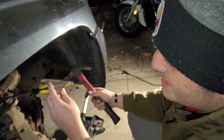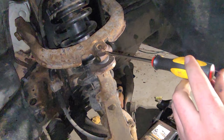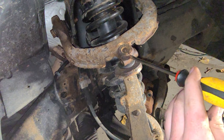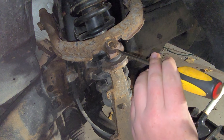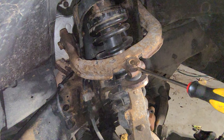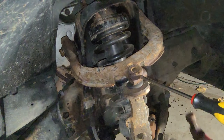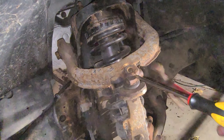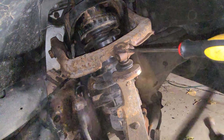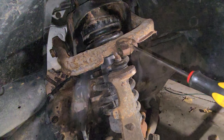With this car being from 2006, it got a little old. These are all probably original parts, so it was a little stuck. In order to open this up to let this rod go so we can bang this off, we put a screwdriver in between this little gap and hammer it just a little bit. It was starting to come free — and there it goes.